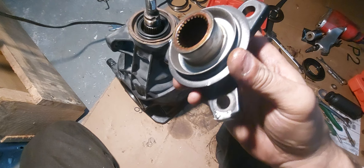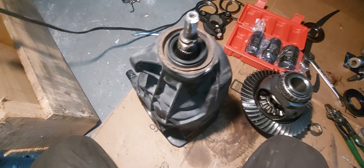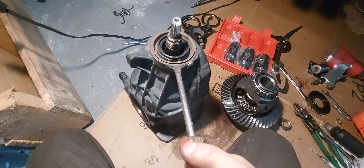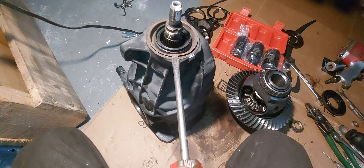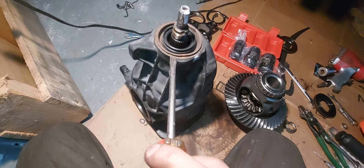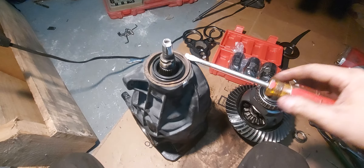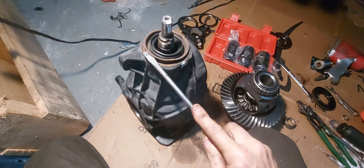Now the seal — this is how I got the seal off. I took the screwdriver and you can't get under it right away when you first hit it, but you put the screwdriver like this and you hit it just a little bit. Don't smash it in — you don't have to dent it all the way in, just a little bit. Do that all the way around, keep tapping it all the way around, then put the screwdriver underneath it and the seal should come off.